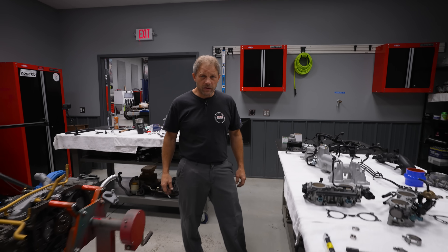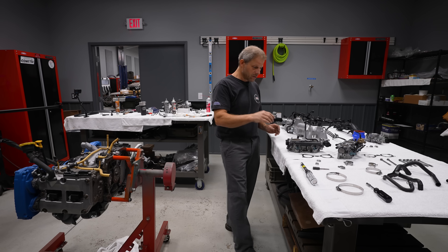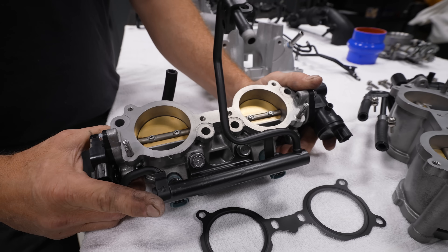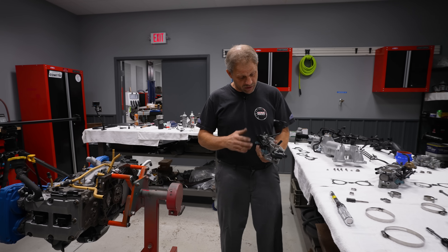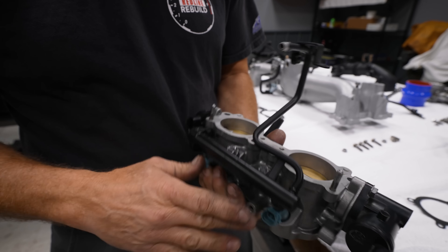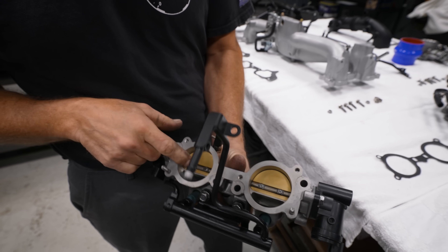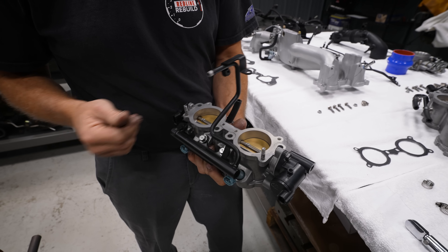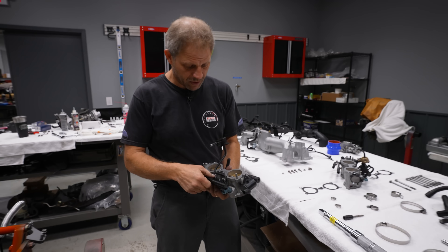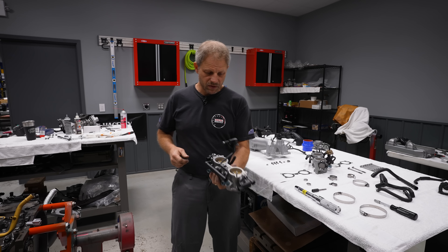Ready to finish out our puzzle pieces here for the intake manifold. On the intake side, we're going to start with these glamorous emissions controls. This is kind of interesting because it is a runner for the air and fuel mixture — you have your injectors here — but it also has these flappers, which are not relative to the throttle body; they're there for emissions. As my understanding is, these things basically create turbulence at whatever specified RPM to keep that fuel moving and burning. It seems complex to me.